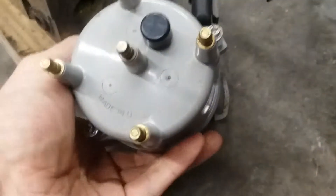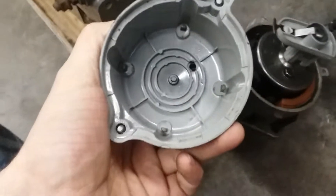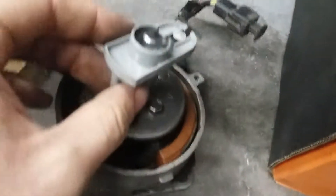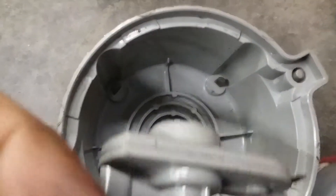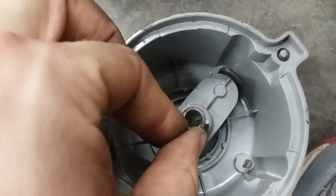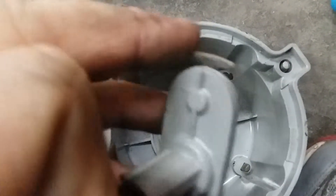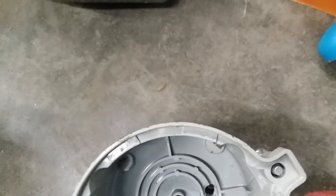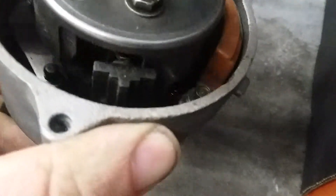On the other end this is the cap. It's just two screws to get the cap off. The cap comes off and then you have your rotor and your rotor plate. How this works is it's all connected directly to the cam. The center post rides up against the center of the distributor, because that center post goes to your ignition coil. This outer spade runs past these sensor coils. As this timing plate or rotor plate spins by and goes past these sensor coils, it helps time your spark.